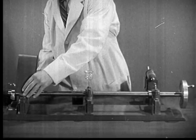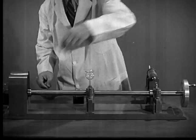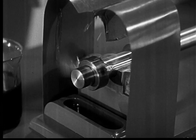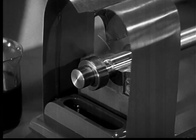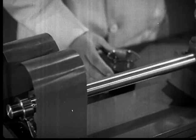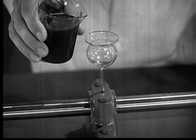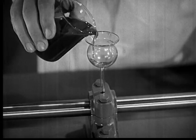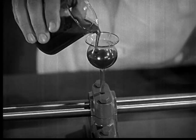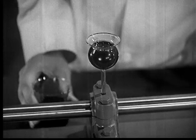There are three general ways of circulating a supply of lubricating oil to the parts of a machine. We can arrange a bath of oil so that moving parts can splash into it for lubrication. We can provide a supply of oil on a higher level so that it will trickle down through a system of tubing onto the moving parts. The force of gravity furnishes the power to carry a steady flow of lubricant where it is needed.